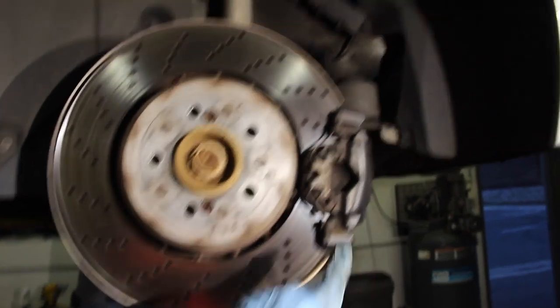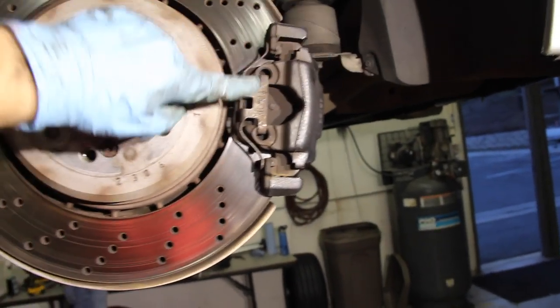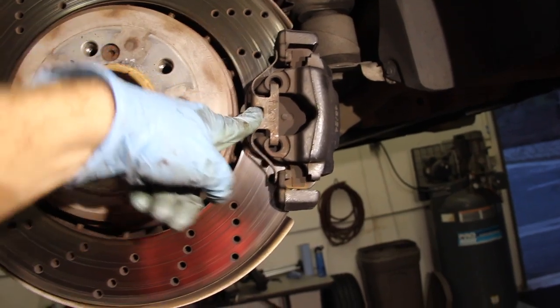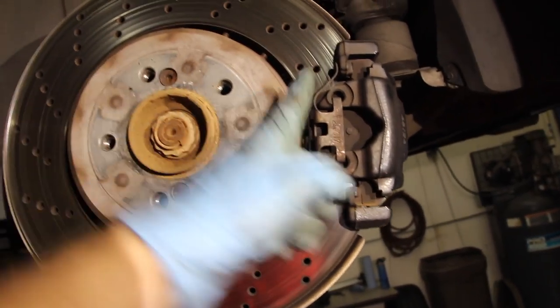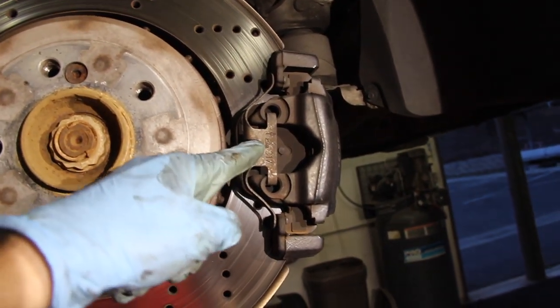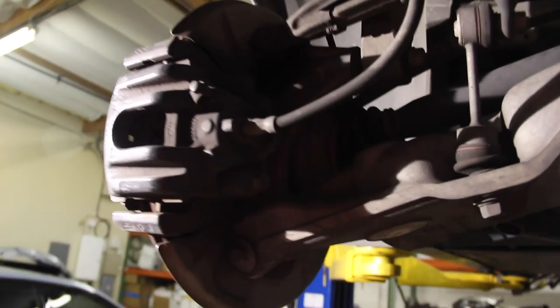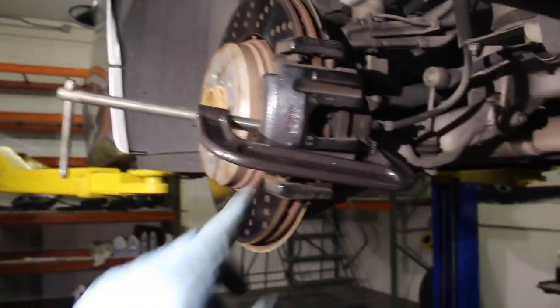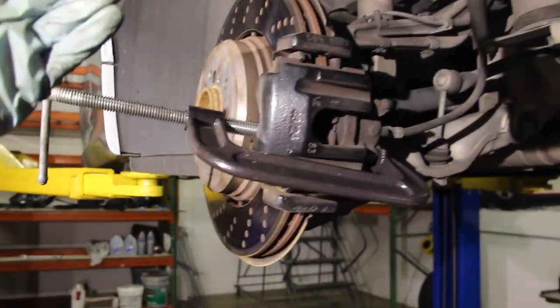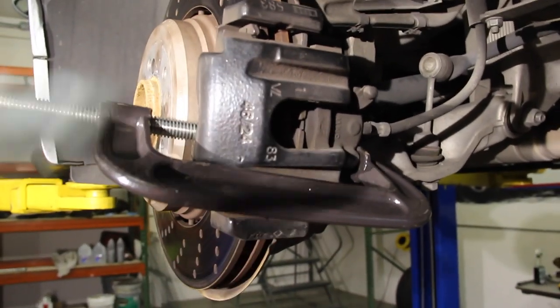Moving on to the rear axle - it's largely the same as the front, although the caliper is a heck of a lot smaller. We've only got one piston, and we have a completely different anti-rattle clip - we're replacing these if they're more than a few years old; it's recommended that you do that. On the E60 this sits a lot wider, so I take a flathead screwdriver, put it in this groove right here, and tap it - that forces it out and it falls to the floor. Just like the front, we come around to the back, pry out the little plastic plugs that hide the 7mm slider bolts, take the caps off, and remove the bolts. You don't need nearly as big of a C-clamp back here, but I'm using the same one.